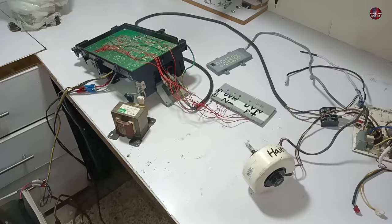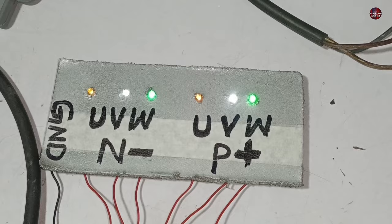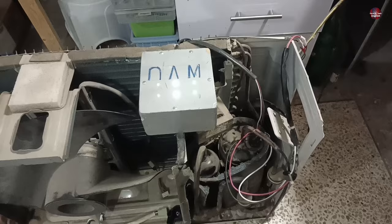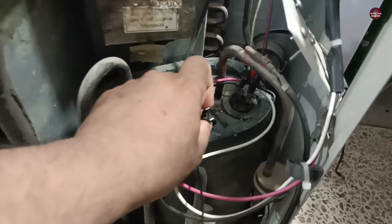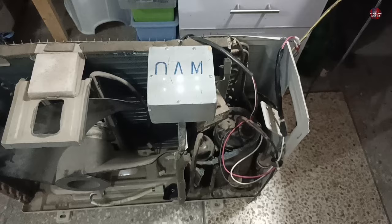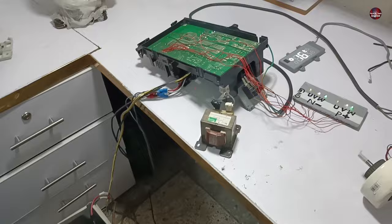I turned on the indoor motherboard to check it. The outdoor motherboard started to operate and all the LEDs on my test device turned on — the voltage coming from the microcontroller is fine. All the IGBTs are turning on, as shown on the analyzer through the LED lights. The compressor had only worked for 10 seconds on its original outdoor unit, but now it has been running for more than 1 minute. The pipe has got a little colder and the speed of the compressor has also changed. This means the motherboard is working absolutely fine on this unit.